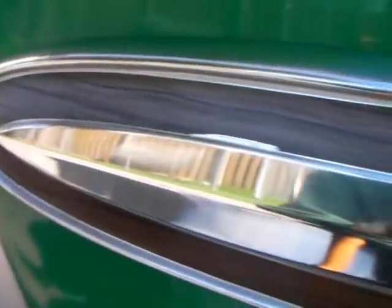It just takes a little time and patience. I should mask off my truck, which I'm going to start doing, because this started out as an experiment. I'm going to pull the headlight trim all off the truck to do it, because it's a really big piece. I also have to do the top of the truck. I did this section with 220 — now I'm going to hit it with 320, then 400 and 600, and we'll see how it shines up.